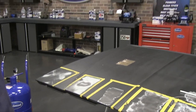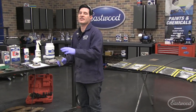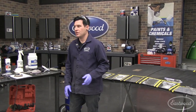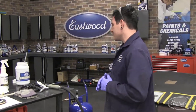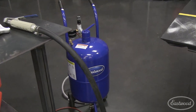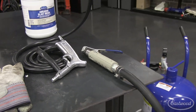So those are the big ways you can do it at home with little investment — things that aren't a big investment. You don't need giant tools; you can use an angle grinder and a DA sander, which are common things a lot of you probably have. If you're doing a lot of restorations and really getting in depth with stripping paint off a vehicle, you may want to think about investing in media blasting. I have one of our pressure blasters here. Basically you're pressurizing the media — sometimes called sand blasting, which isn't really a correct term. You don't want to be using play sand; use specific blasting media.